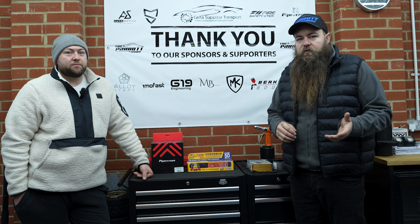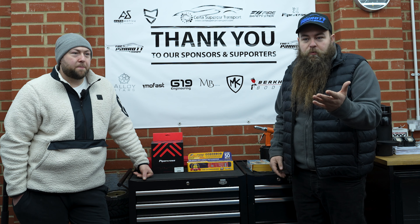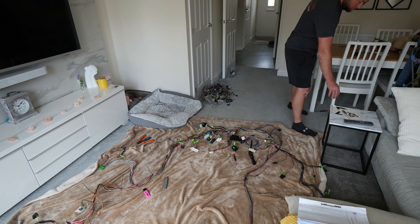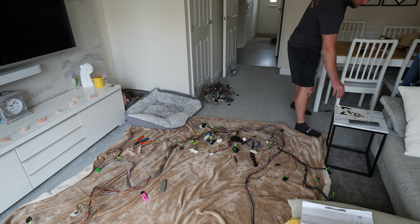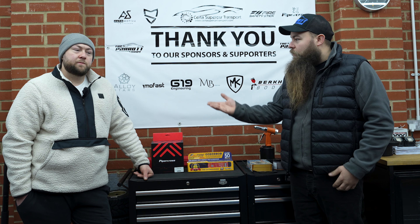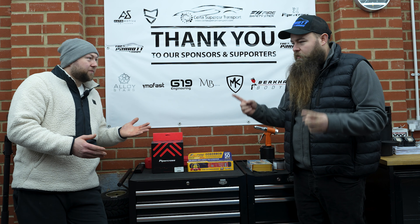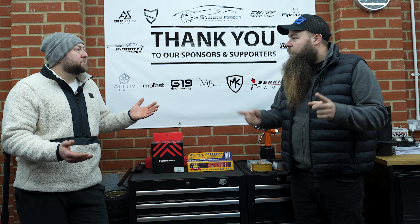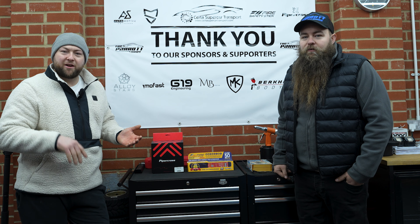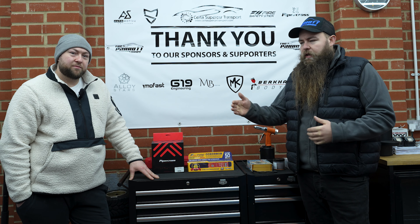Because MK make the guide for the RX-5, now that could have five, ten engines. You could be putting in a different engine to what they've designed it for, and things are different. Plus, as they go along, they might make things slightly better, but the guide might lag behind. The version you have might be old — and you're cutting things like our brake pipes to the lengths in there, and then you go to fit them, and they are short. You flip the next page and it says cut 100mm, then it says cut 150mm, something like that. The best thing we've learned with that, with the guide, is definitely read ahead — maybe ten pages. Go through to the next couple of jobs, make a list of what you need.